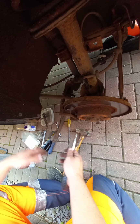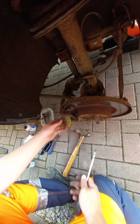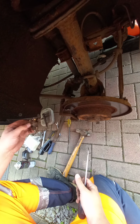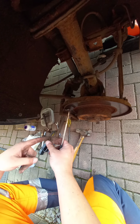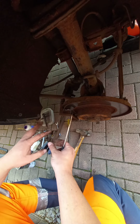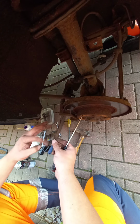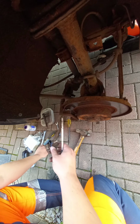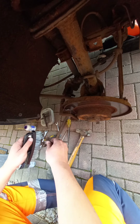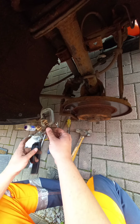We have got some hardware, which you should change as often as you can on your brakes, because it does actually wear with the brakes. And I never tend to put lubricant on these parts of the brakes, I put it underneath, because these are stainless steel. And in effect, if you have a look, these don't actually rust. You see?